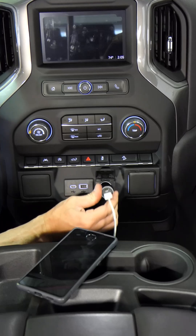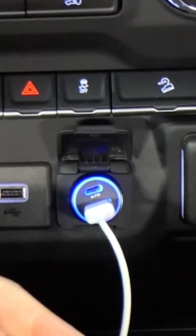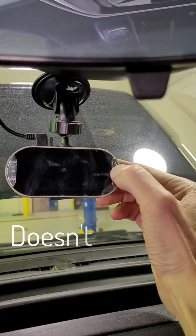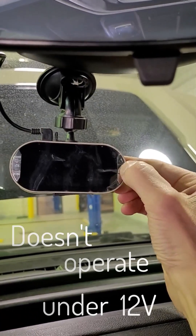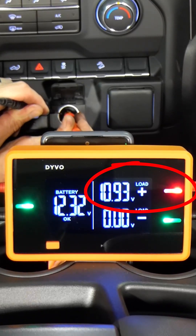If you're wondering why I didn't plug something else into the outlet to see if it works — I did, and it actually worked. The reason the dash cam didn't come on is because it has software that prevents it from turning on under 12 volts to save your battery. The outlet only had 10.9 volts on it, so the dash cam wouldn't power on.